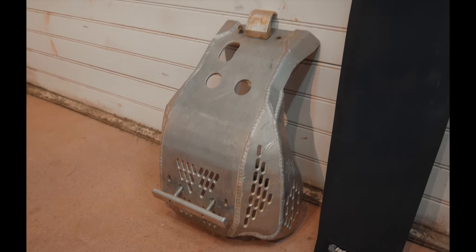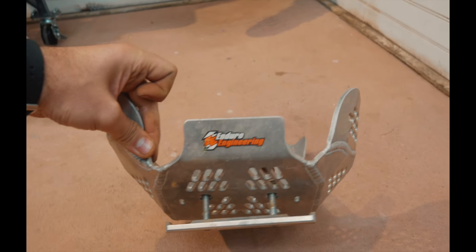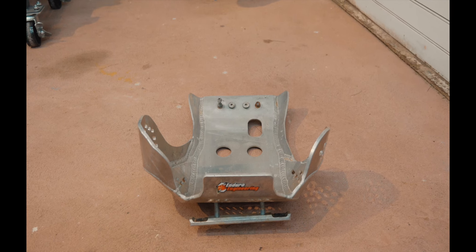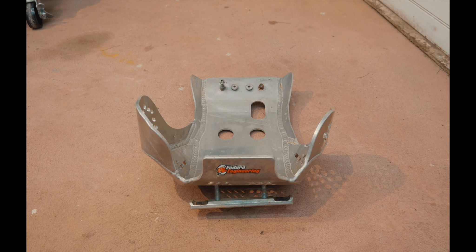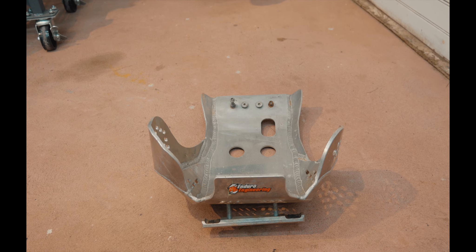I was running an Enduro Engineering aluminum skid plate. I really like it — on this side you can see it covers the water pump. One thing you'll find when you're running an aluminum skid plate is it does reverberate quite a bit. You get a lot of the engine noise reflected back on these little wings, and if you're not wearing earplugs it can be quite deafening. People have sprayed it with bed liner, put foam pads on it, tried to dampen it from the frame. I'm sure a combination works — I just haven't found what works for me yet.